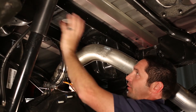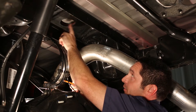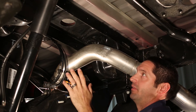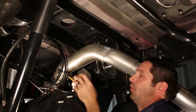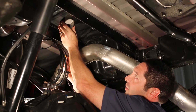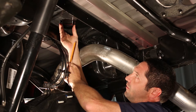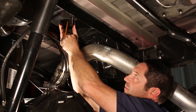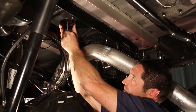Here's the all-new cross member we talked about earlier. You're going to notice that they've already provided a three and a half inch hole in the factory cross member, which is designed just for the gooseneck ball. Something you're really going to like about this new hitch is we don't have to do any measurements inside the bed for gooseneck placement. They've given us a nice little template that you raise right up inside the factory hole. You can see the hole in the template — just raise it up inside the hole and it centers itself perfectly. We've already cut our hole in the bed here, but we want to show you how that works.